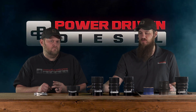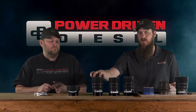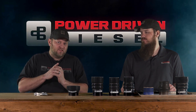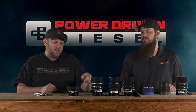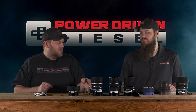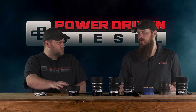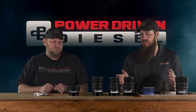This one is special — it's a three-to-three-point-six, nine inches long, and this side right here is an oddball size specifically for the second gen Cummins intercooler connections. On the intercooler they're not three and a half, they're not four. You put a four and they're loose with a bunch of clamps to hold it; you try to get a three and a half with five ply and you can't stretch it — five ply is too stiff. Even with a four ply it's a bear. You need the actual right size, which is why we've done this. The last one is a three-to-four, four inches long — it's a shorty that we use on compound turbos as an interstage boot between the high and low pressure turbos.